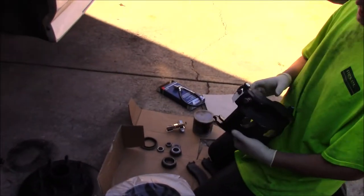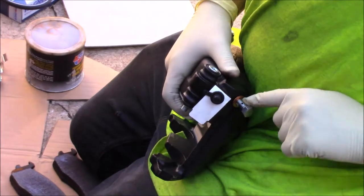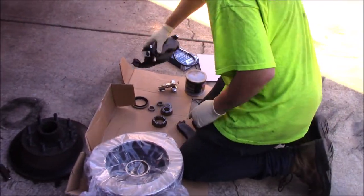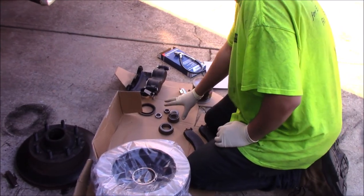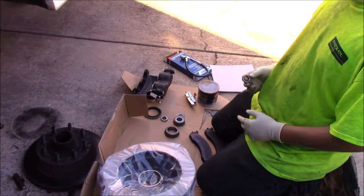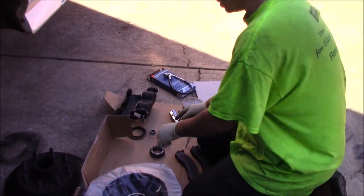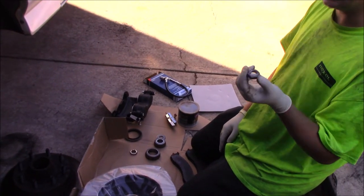These lines are $9 or $18 a piece — it's cheap insurance. Because whenever you have a seized caliper or sticking rotors, it can either be the caliper or the line. The problem with these calipers is we can't pull the bleeder screw so I can't show you how to test and diagnose which one it is. So we just opted to go ahead and buy both and replace it all while we're here. If you're doing calipers, I recommend doing lines. Something to keep in mind whenever you buy new calipers: make sure it has a banjo bolt. This is something you want to replace, and these copper washers should come with it — one from the top and one from the bottom.